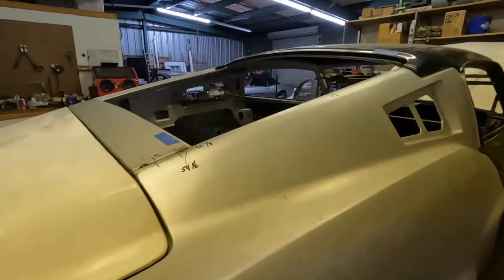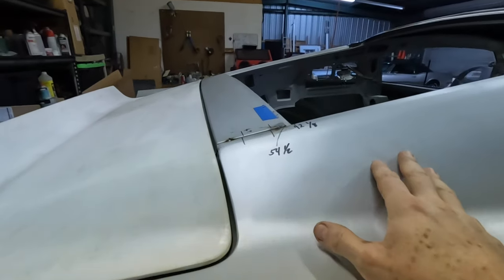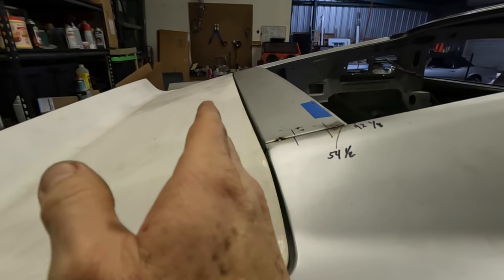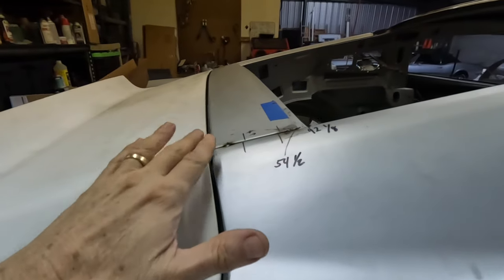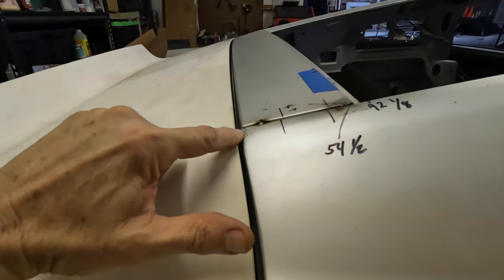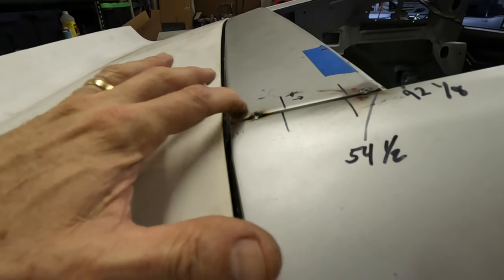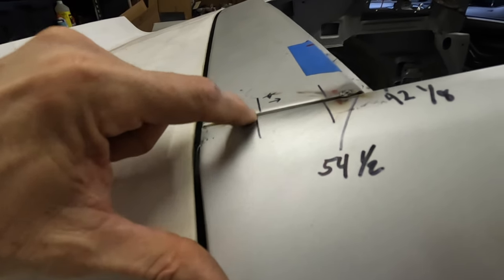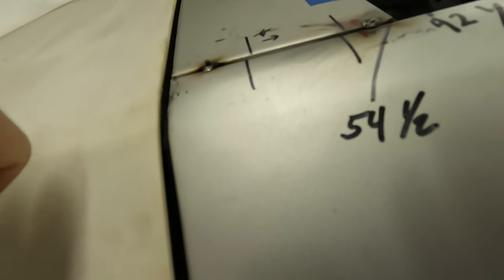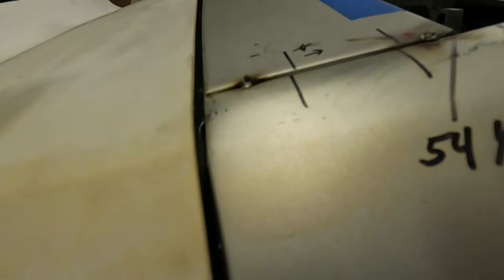One of the first problems I had was with this piece right here, and the way it fit the way it came from Dynacorn — this piece came in and kind of went out a little bit, giving you a turn. What that did is make you want to put the transition piece at the end of that, so this piece actually sat further down. The natural tendency is to move it down. What I did is I folded that metal up under there, just tapped it in and bent it down a little bit. You're going to metal finish that and never notice it because it's going to be welded.